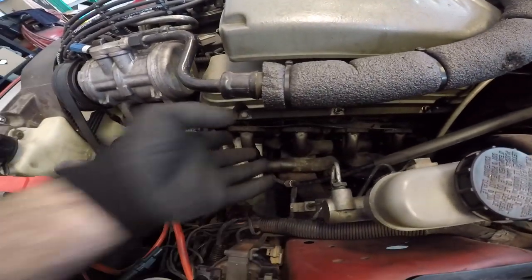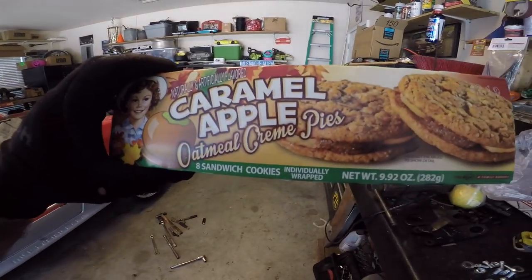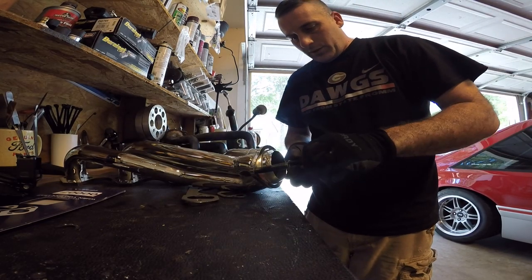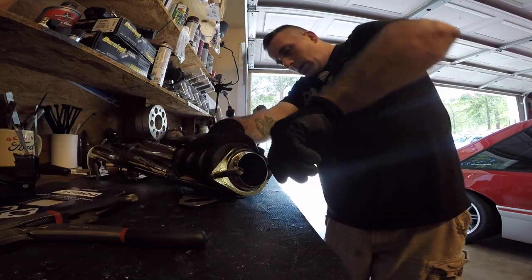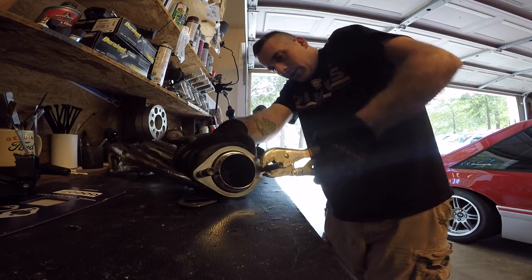They fit really good — and how do I know that? Because I've already got one on. We're going to go ahead and take this header out and show you what they look like in the car. Everything is unbolted just like it was last night. To prepare the headers for install, all you do is take your studs and screw those in — just bottom them out and they're good to go. There's a flat spot where no threads are, so if you need to grab it and turn it, just use some vice grips. A lot of times the threads in the chroming process get a little galled up, so it'll take a little bit of pressure to get them all the way through.